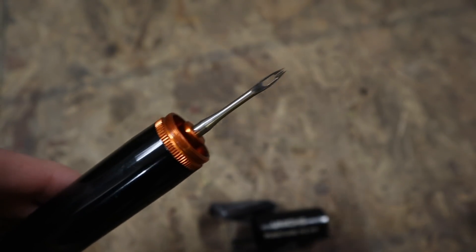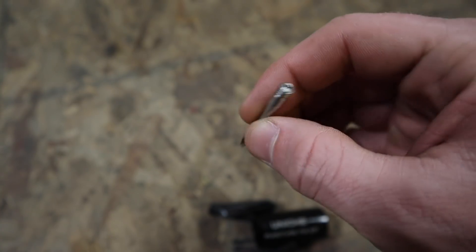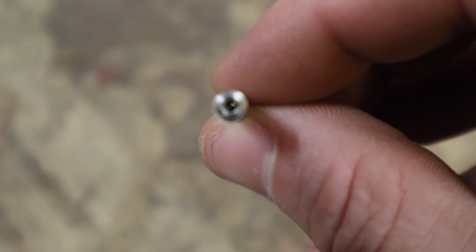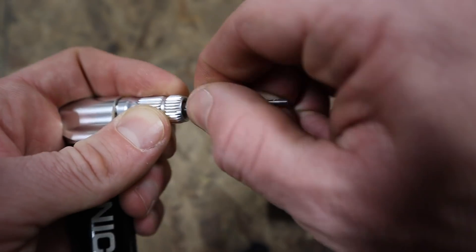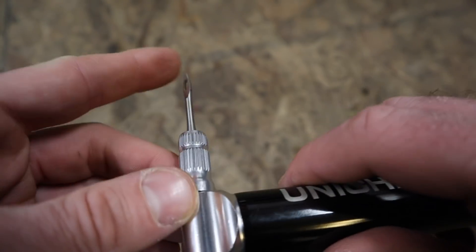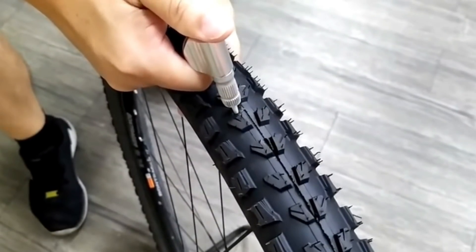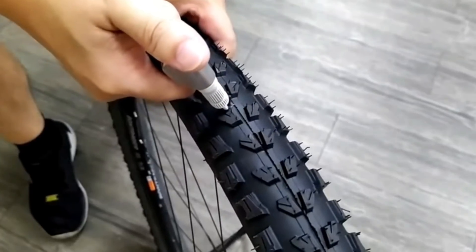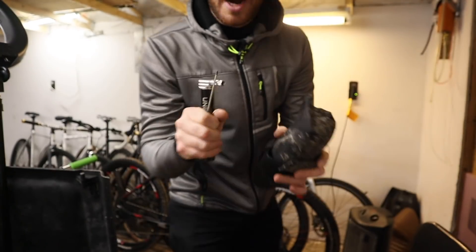On this end, when you see me and Colin fixing the puncture that we created in the woods, this is what holds the bacon strip. The cool part — and if I had done my homework before I went out — is it has a hole machined through it. The threaded end is the same thread as a Presta valve, which means it'll go into the end of your CO2 applicator. Then you've got an applicator with a hole through it that can accept CO2 air. So once you get your CO2 on there, pick the bacon strip you want, pierce it through the hole in the tire, fill it back up, pull it out, let the sealant do its thing — you've got air in the tire.